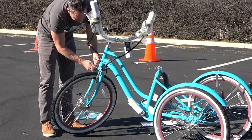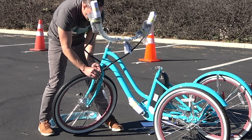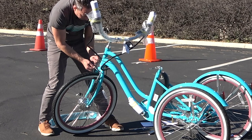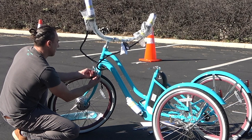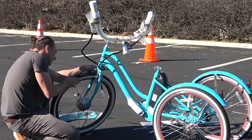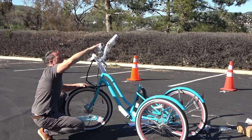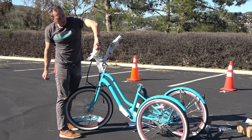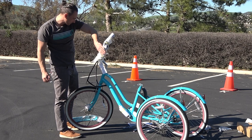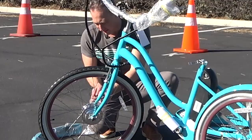Now you can reattach the brakes. The brakes may require some adjustment — this one's a little too tight. I'm going to grab my 5 millimeter and loosen them up a little bit. Here's the pinch bolt with cable. I'm going to leave it a little loose, hook it back into the noodle, and then pull it back to the tension that I like. Tighten the pinch bolt back up. With the lever feel, you want to basically be able to pull the lever and start to feel some resistance about halfway through — you never want to be able to pull the lever all the way to the handlebar.